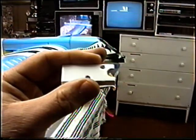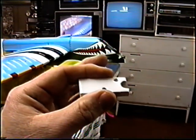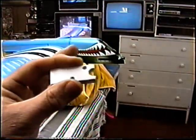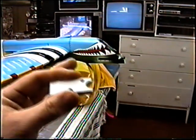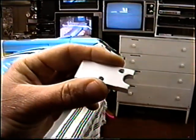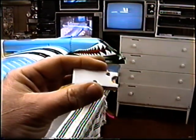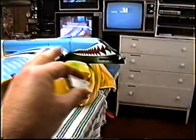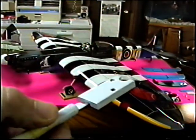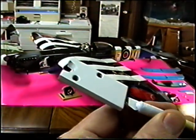For this very first coat, I want it on relatively thick. I'm not concerned with chemical adhesion right now — I'm not going to put any more tape over this plane. Each time I spray another coat, just add maybe a spoonful of thinner to the gun, so toward the end I'll be up around maybe 70% thinner. Then that last coat will flow right out. Let's get a little test on this and then set it aside to dry.